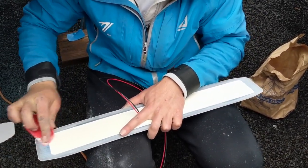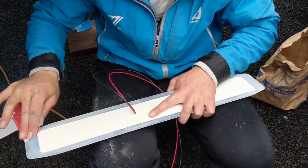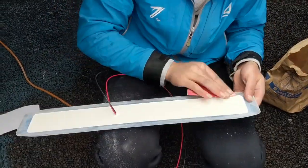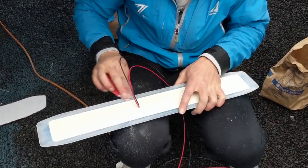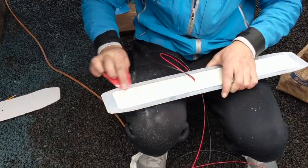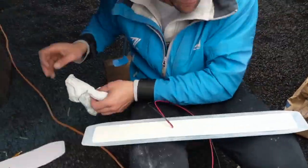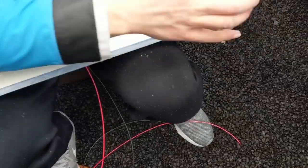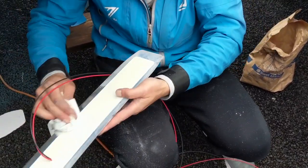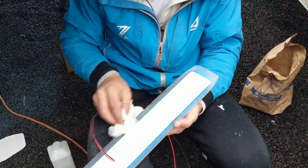Work your way around the whole light making sure there are no glossy bits of the bezel left over. You can sand the back of the light where the white potting material is as well — you basically want the whole light to be nice and rough, no glossy sections showing. Then take some 91% isopropyl alcohol and wipe all the dust off the back of the light with a clean paper towel. Make sure all your lights are prepped with everything nice and clean, nice and dry. Don't rush this point.